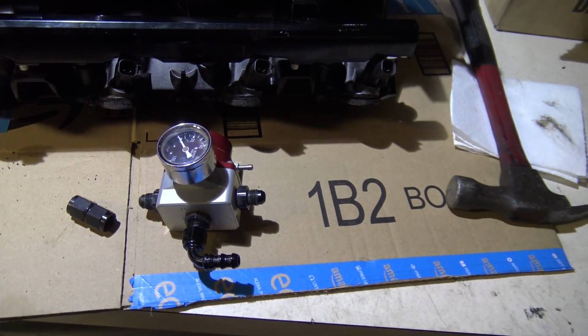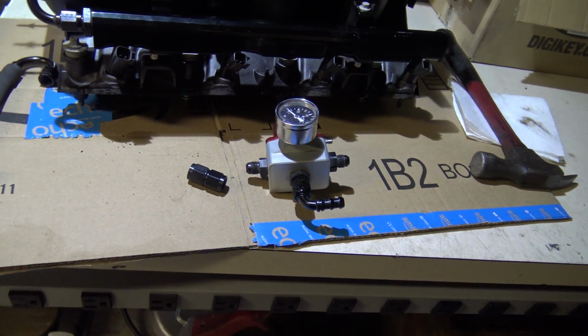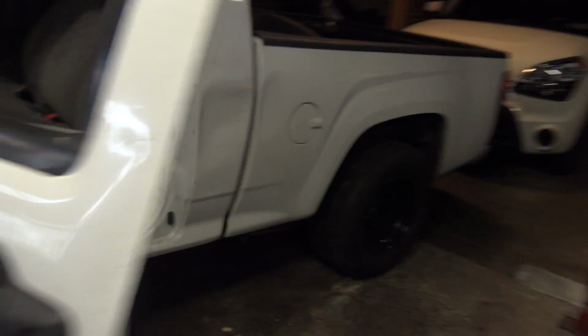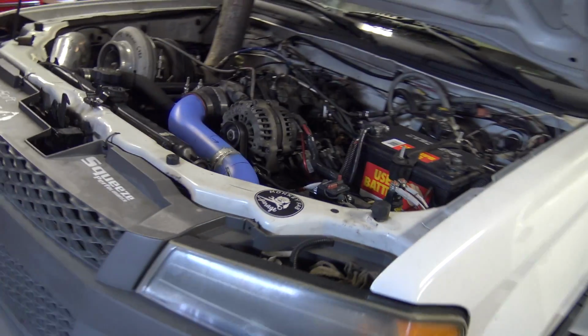And I'm probably gonna get rid of the stock 3/8 hardline, because I have the 3/8 bulkhead in the hat right now. So I'll just add another and make that the return. So, no bullshit, try to do an internal pump. If not, maybe I'll throw up a picture of it. But XRP diesel or XDP or whatever, they make plastic sumps for these plastic fuel tanks, for the diesel guys, and it has 1/2-inch fittings on it. So I might do that, and a MagnaFuel 4303, and hope it goes far enough. I might need another or something else on it, so that's why I'd rather just do the triple 450s down in my tank there, because I have 2 already, and I figure a massive feed and some rails with the split and everything else all working correctly should do the trick.